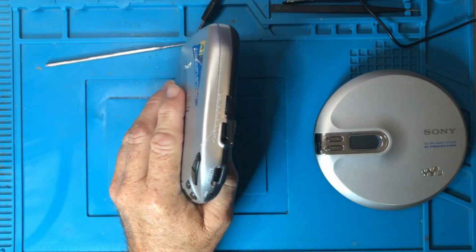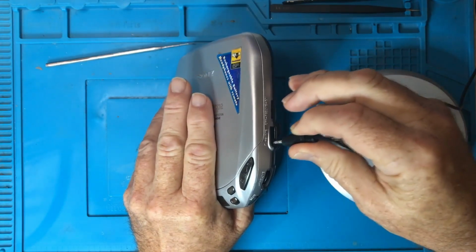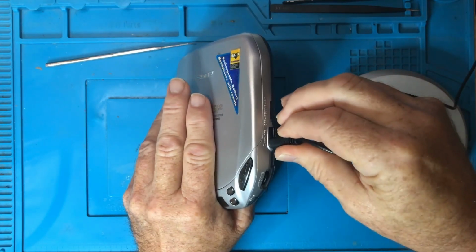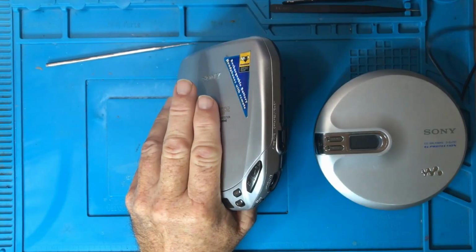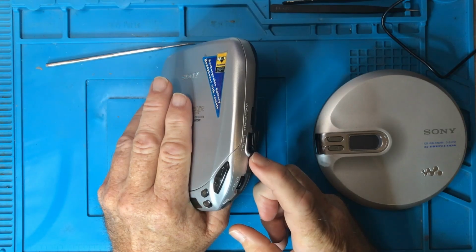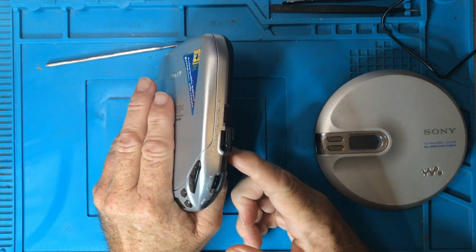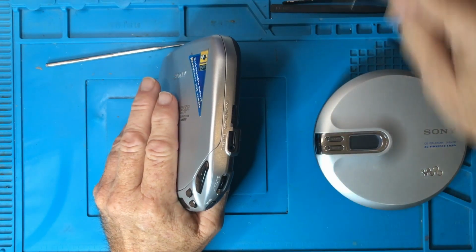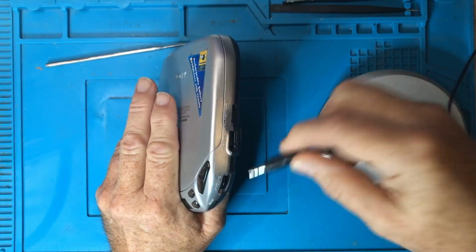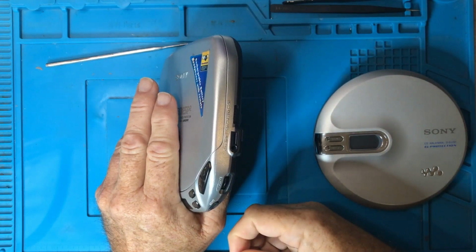just basically get some headphones. I'll just use this jack, and you get that in there, and you would just keep doing that to try and break the oxidization or rub the oxidization off the internals. Right now, what would be better is if you use some isopropyl alcohol, or better still, contact cleaner. Spray that in there, because contact cleaner is especially designed to clean the contacts. So you spray it into there, and when it's in there, you then go ahead and do this. And the combination of the two is the best method for cleaning internally without having to pull anything apart.